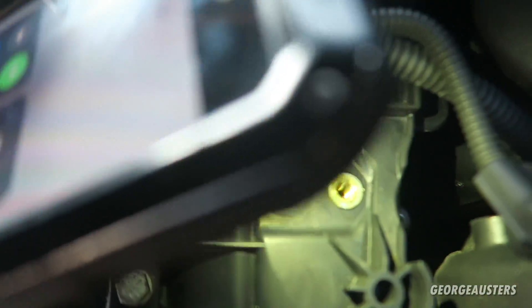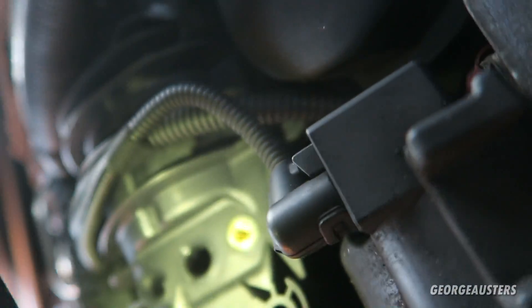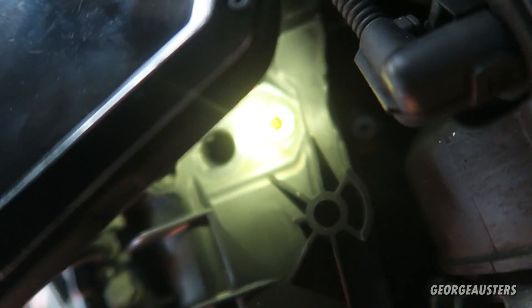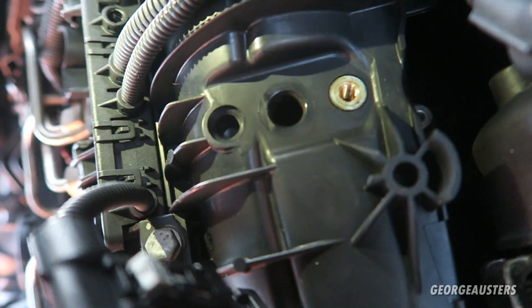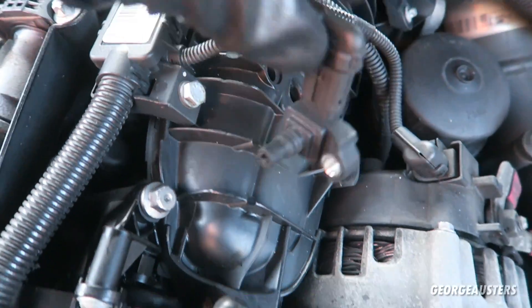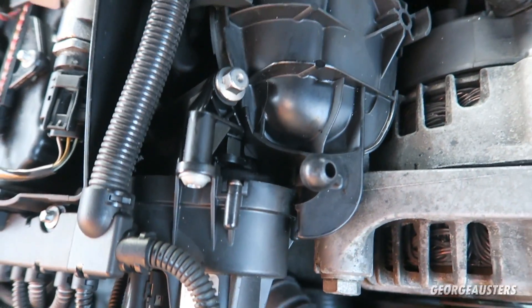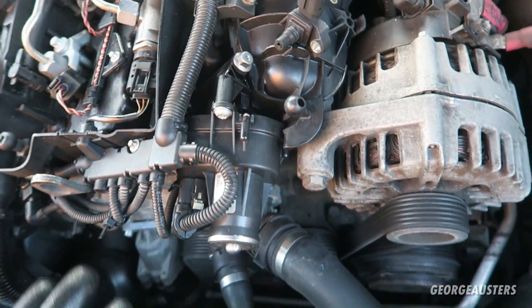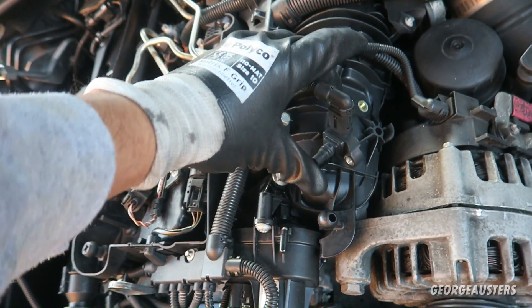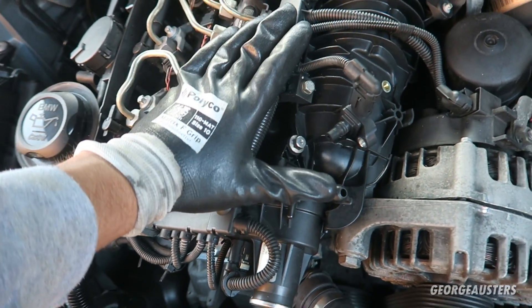Let me get a torch so you can see into the intake manifold itself. Using a torch — or an iPhone — I can see in there myself, and there's lots of carbon buildup, which is obviously what I expected. Some of that carbon buildup is actually inside the MAP sensor itself. So we'll be cleaning the sensor out — probably just use a screwdriver to scrape it out and clean the outside too. At a later date we will be removing the whole intake manifold, cleaning it out including all the swirl flaps, and possibly cleaning the intake ports on the engine block as well.